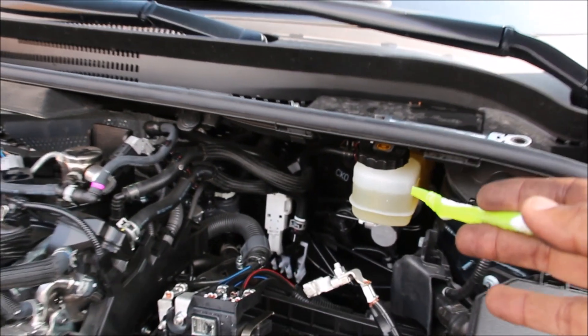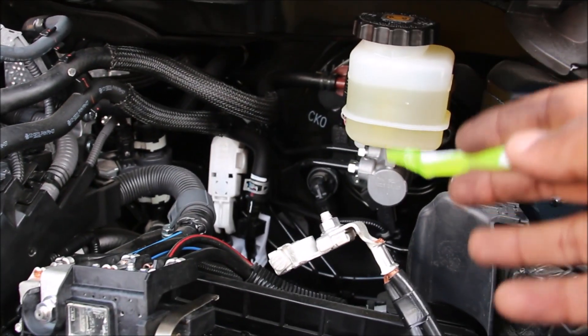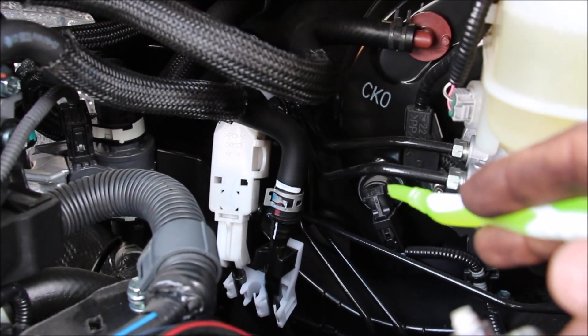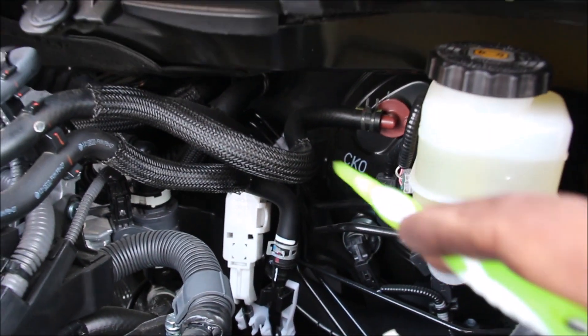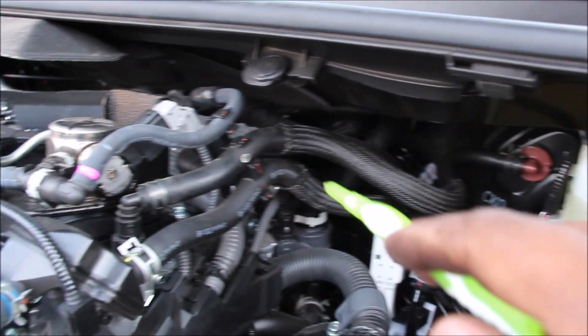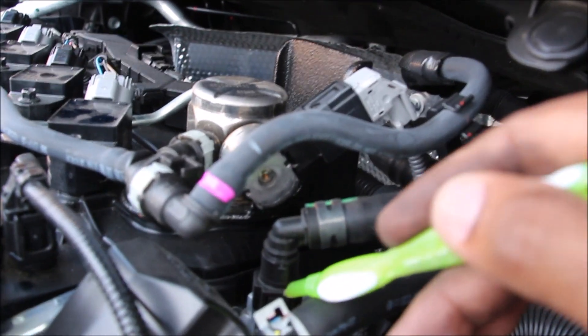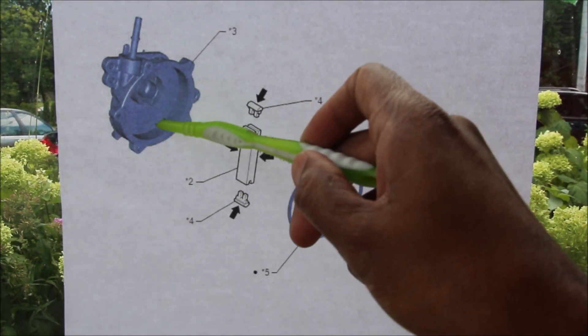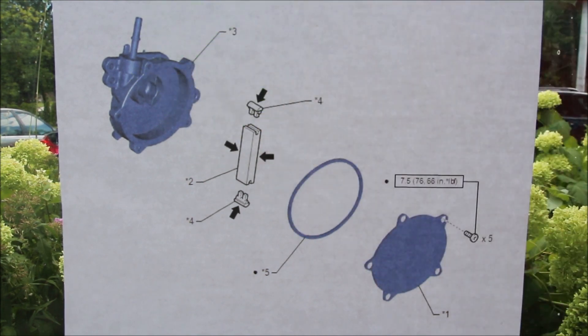Taking a look at the braking system, we have the brake master cylinder and the brake booster over here. There is a sensor for vacuum, and that's because this vehicle does not use engine vacuum to drive the brake booster. It actually uses a vacuum pump inside of here that's driven off of the exhaust cam gear. The vacuum pump has a vane on the inside that spins around inside the housing to create that vacuum on the inlet.